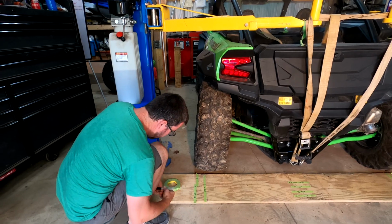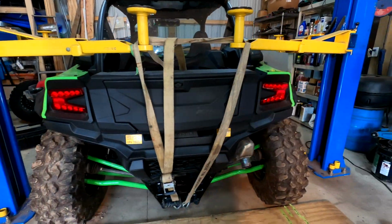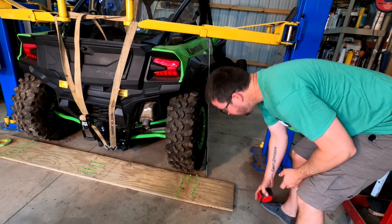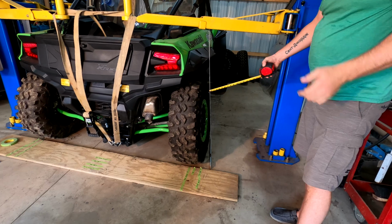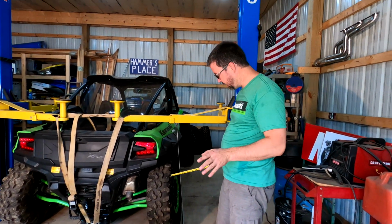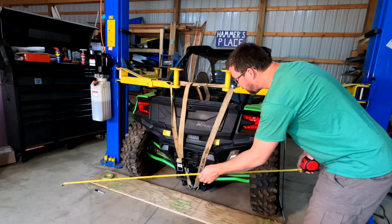Comp. We've got a lot of angle here in a negative. It went negative camber. This could be where Justin was talking about, because look what this tire has done now. So maybe what he was describing was in compression, from ride height to compression, they've worked out the whole scrub issue. So let's check that. We'll verify that right now.